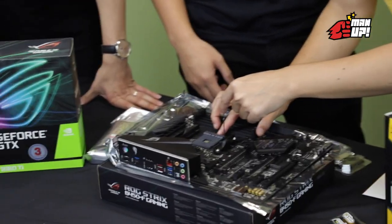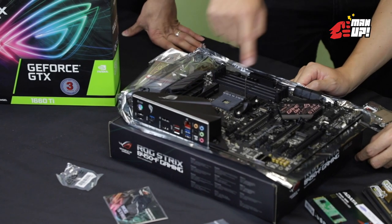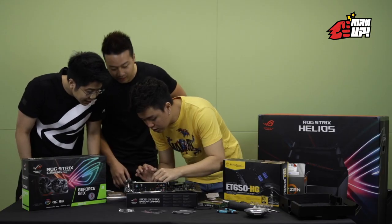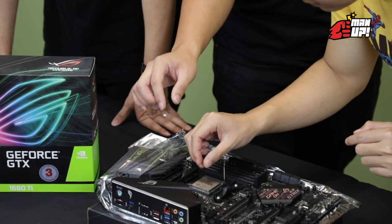If the camera can see — here there's a little arrow at this corner. And on your CPU there should be an arrow also. Gotta be very, very gentle. Is it in? Yes, now it's in. Then you can wiggle it a bit to see whether it's really seated in, just gently.